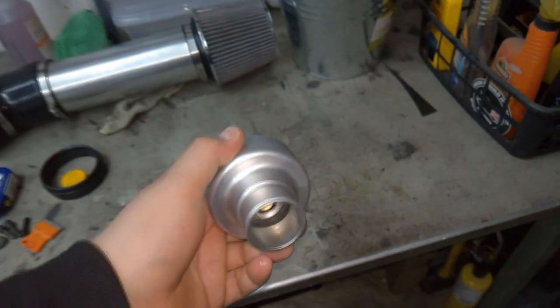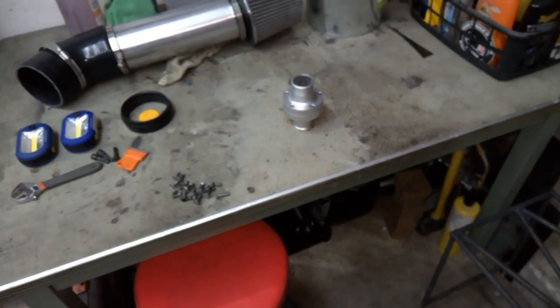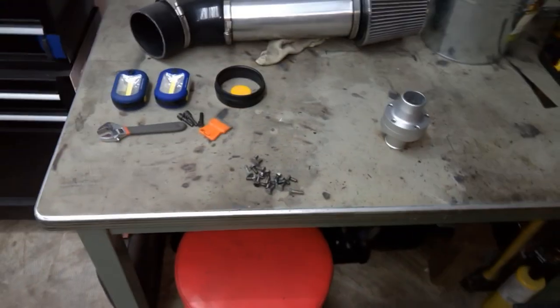This was disappointing — this did not work as well as I thought. I tested the thermostat beforehand to make sure I didn't get a dud. That didn't really work out in my case. This thing really blocked up the flow — it did a really bad job of opening at temperature. When I tested it, it did open, but it opened a little later, like 195-ish. I know it's not supposed to open right at 180, but 195, 200.